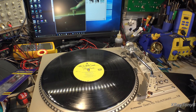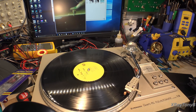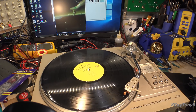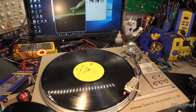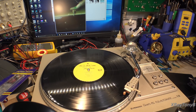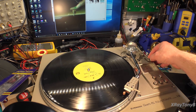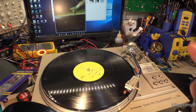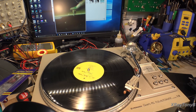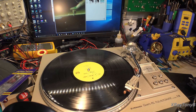This record needs cleaned before I really play it or I'll gunk up my new needle. But I'll do a needle drop here so you can just see it go - I did clean the record, it's not spotless but it's okay. I can pretty much hear it over my yelling and screaming family. Anyway, what I'll need to do now is try it out and play it a little bit, make sure that it doesn't skip or anything, and make sure the anti-skate is set properly. Anti-skate is another thing that you have to set by ear. If you're tracking at two grams and you set the anti-skate at two it's definitely going to be in the ballpark, but you can actually fine-tune it from there.